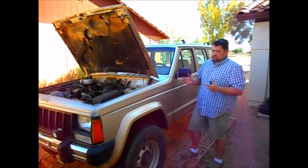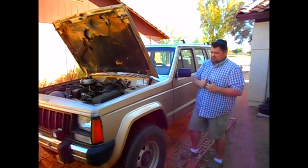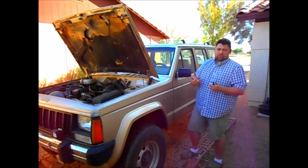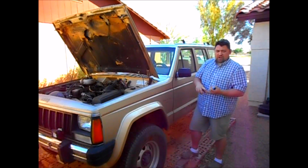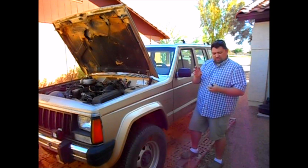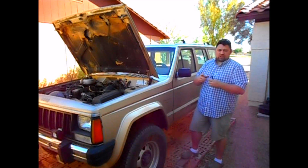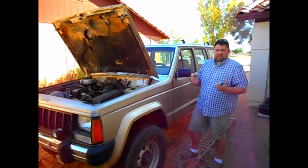And so that way, just hopefully in a minute here, I won't do this with the camera on because I want to make sure I pay attention to what I'm doing. And I'm actually going to reverse it a few feet and pull it forward a few feet. Just make sure the brakes aren't frozen, that the bearings get grease back through them, and that the U-joints get that grease worked through them some more. And then again, in a few more times, I'll come through, I'll hit everything that I can with the grease gun. Just make sure it all has nice fresh grease in it.